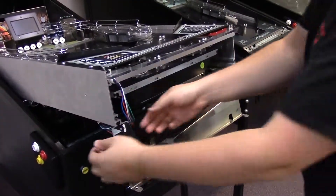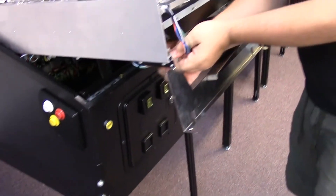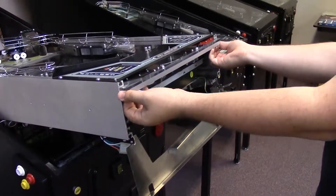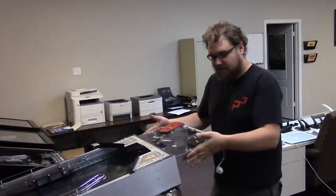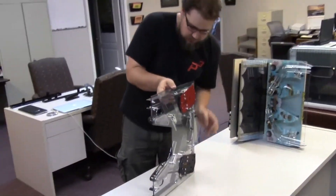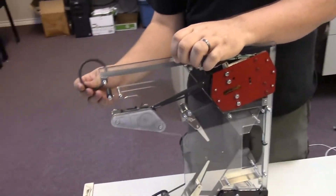We have to disconnect the power first before we remove it. There is a connector in here, and this connector can have a little bit of extra friction on it the first few times you remove it. Pull straight outwards and then you can take it right to your workbench to make any adjustments, clean the components, or replace a flipper or slingshot rubber — it's just this simple.